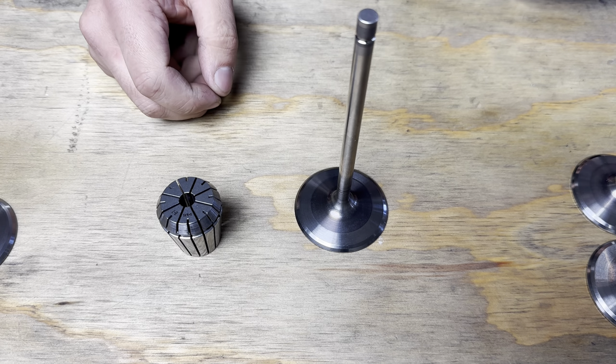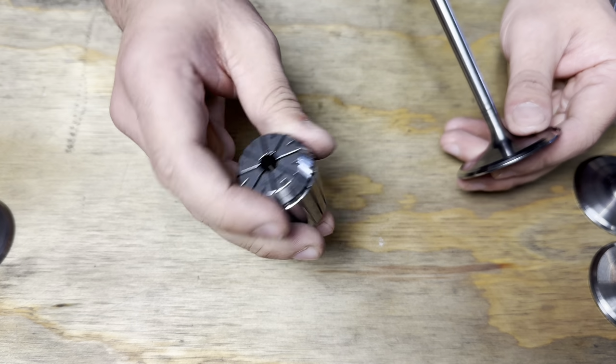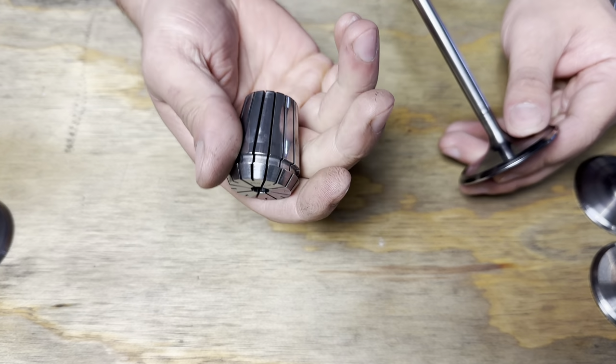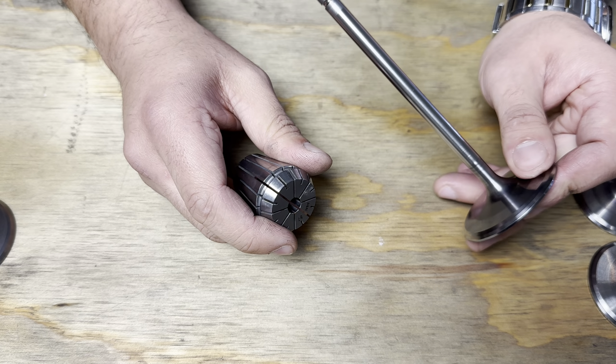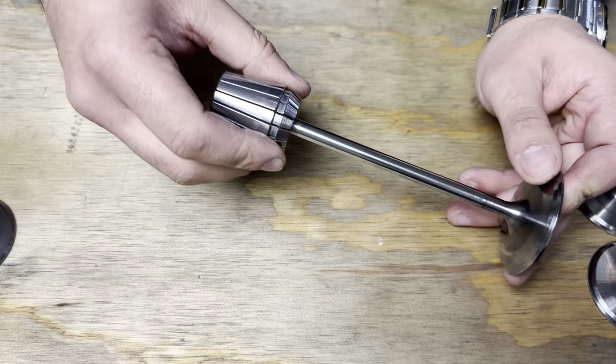Now, you've got to have some special grinding oil in your valve grinder, and then you should have a high precision chuck or a centerless grinder of some sort. If you decide to do this in your worn out Quick Way or your worn out Sioux, all you're deciding to do is waste everybody's time and probably waste everybody's money as well.